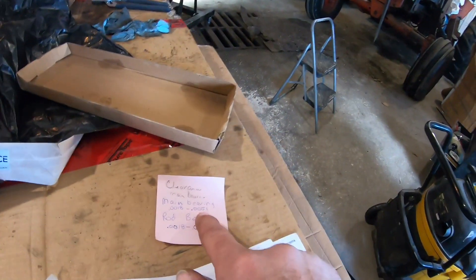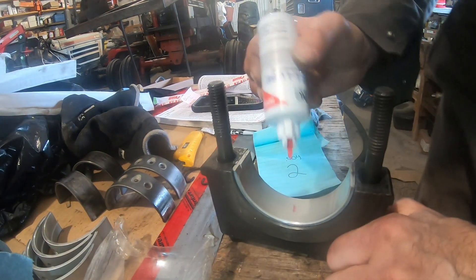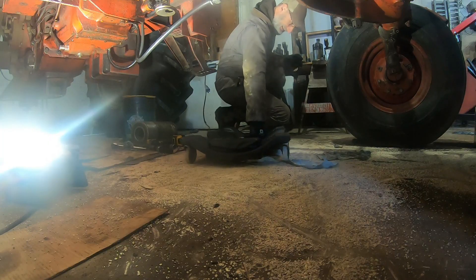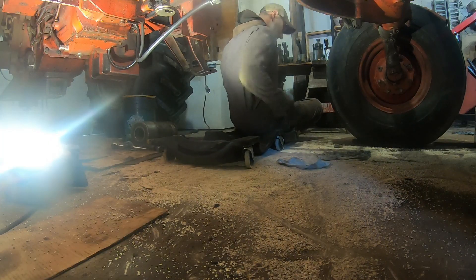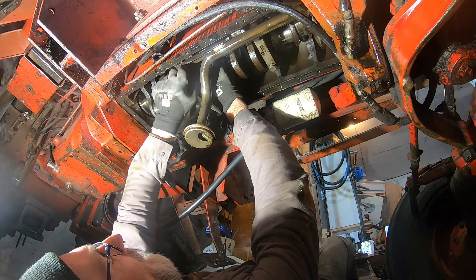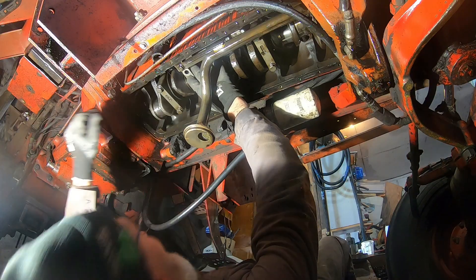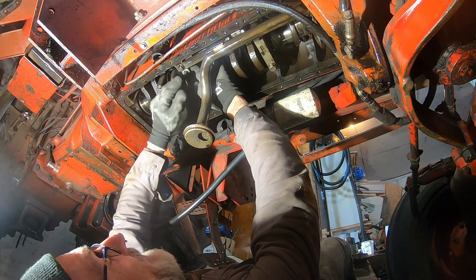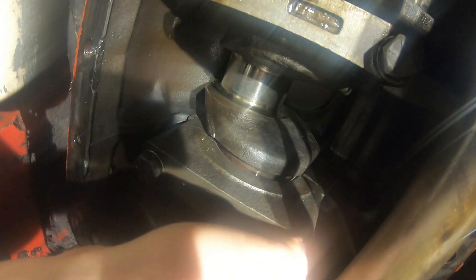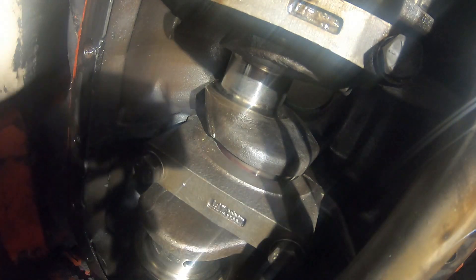It's point one, so I am actually good — I'm underneath that threshold. We are good. Now what we're going to do is put a bunch of oil on this side inside here, because this is where the crankshaft is going to go. I'll be putting this back on. That hurt — it hit me square. Ow, that hit me right in the middle of the glasses. I just feel a little more comfortable just kind of snugging it by hand. That is in the right direction.